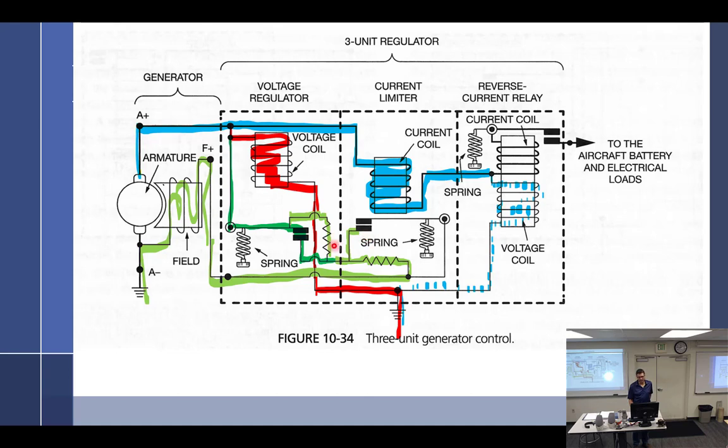Follow? Mm-hmm. All right. Now, I don't know, we could kind of guess what's happening here with these at the same time. It would just depend on what the voltage is doing. If these are vibrating at such a rate that it's causing the voltage over here to drop below the set limit, then these are just going to close. They would pretty much say, oh wait a minute, this is vibrating so much that the voltage over here is now at 12.8, you know, 13. It's not enough. So these would be closed and this would be vibrating. But this scenario is only going to happen when you are hitting the limit of the generator and these start working, which is, I would think, not going to be all the time or often.